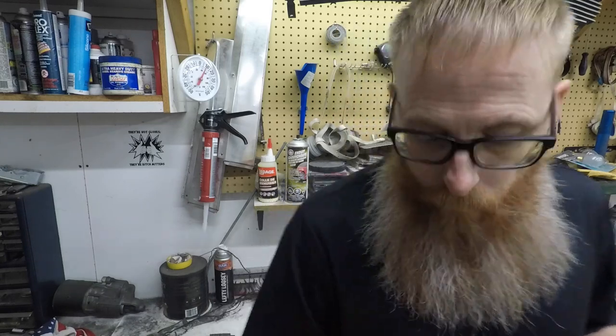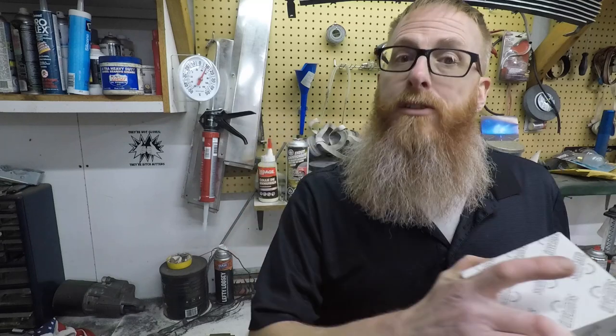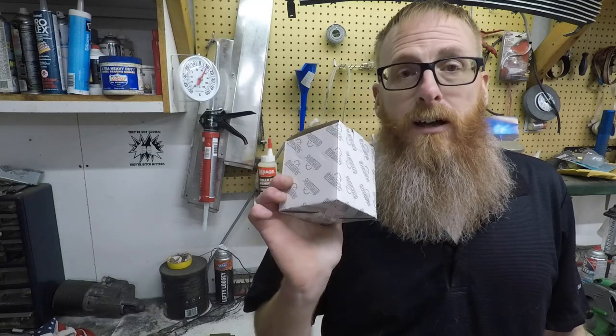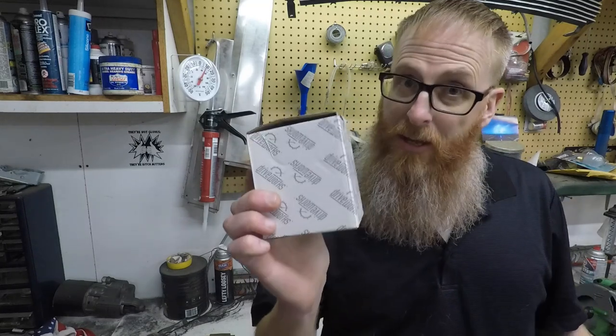The thing I did not mention on the list is the upper control arms. In one of my last videos you saw that when I went to install it, it did not fit — the ball joint was too big. I contacted Rock Auto and they said to send it back and they'd send another one, but I don't want to take the chance of getting another set with the same problem and a two-week turnaround. So what I did was order just the upper ball joints to go onto the new control arms — only $15 and change — with a lifetime warranty. Tonight we're going to swap those in, but first we've got to take a wheel off and make sure this is going to fit in the upper spindle.